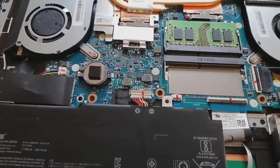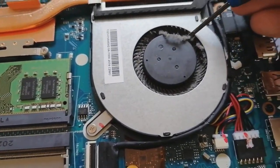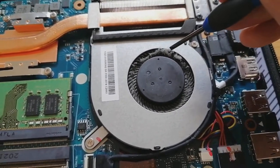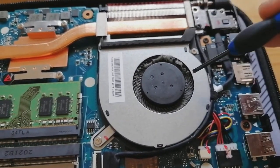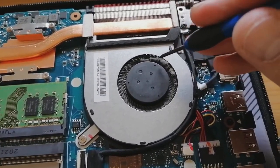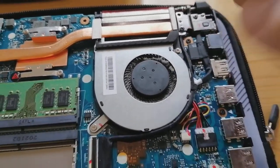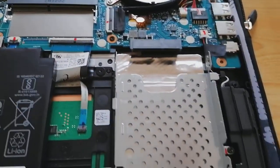This computer is about a year old and as you can see it's already filthy - it needs cleaning out, because otherwise they get noisier and noisier and performance can drop off. We're going to clean all that dust and dirt out of there. Use pressurized aerosol air - you can get pressurized air cans - or if you're careful you can just pick it all out and hover a vacuum cleaner above it; don't touch it directly with it.